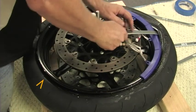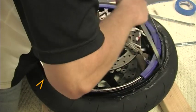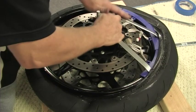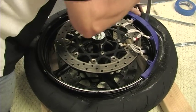Right there, see that? The tire is being pressed deeper into the wheel, and this is exactly what we want to see. Using a second tire iron on the number 4 protector continues to press the bead into the wheel. Now let me stop it one more time. With the first 2 irons about 7 inches apart, the bead is now lifted cleanly over the rim, and it will stay there.